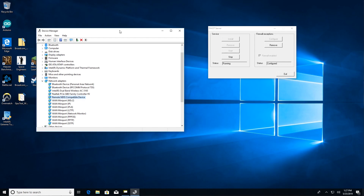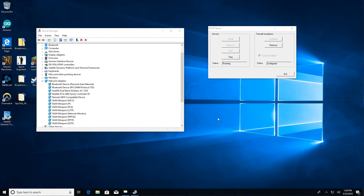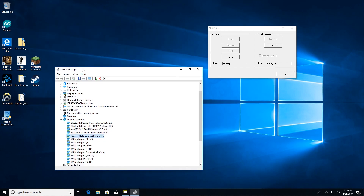It could work on multiple devices, not just the LattePanda. This cable essentially creates a Remote NDIS Compatible Device on both ends — on your Windows machine as well. If you go to Device Manager on your Windows and look under Network, you'll see a Remote NDIS Compatible Device. You don't have to stick with Remote Desktop either — if you're using macOS or Linux you could use NoMachine or VNC.